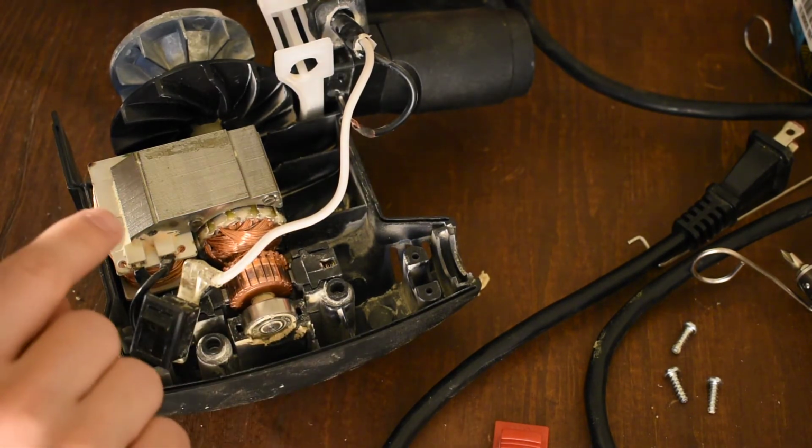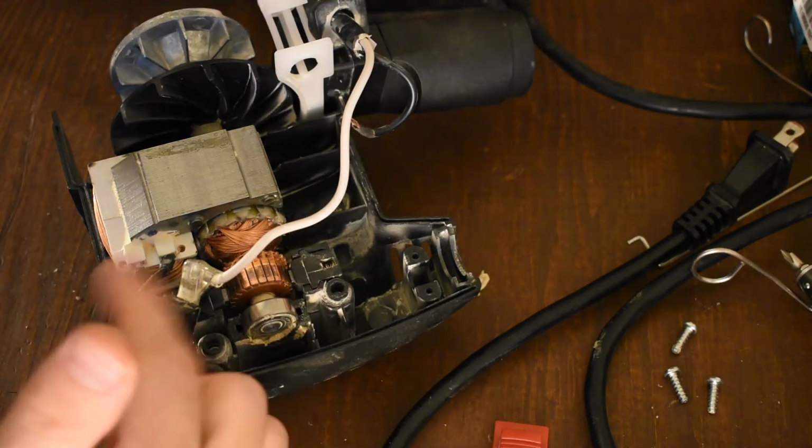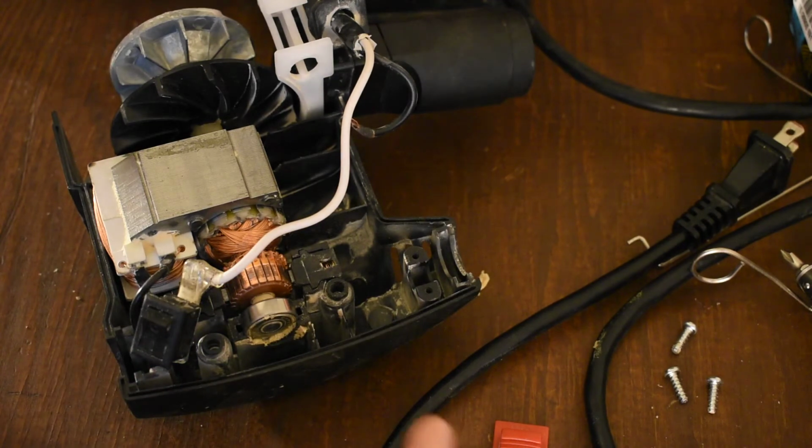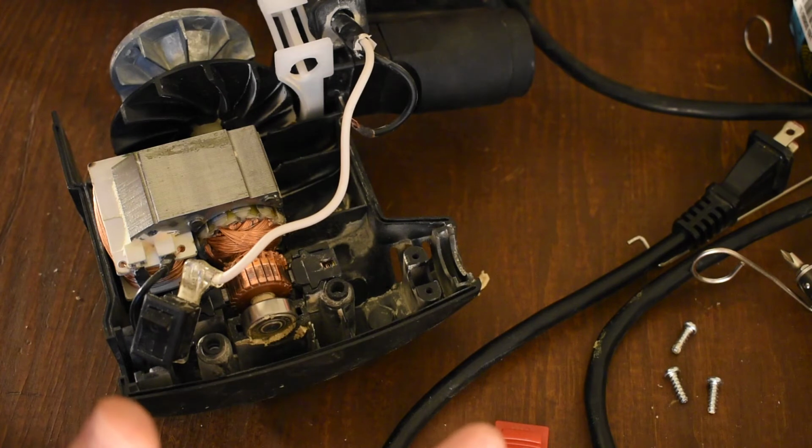They actually frequently won't work if you don't do this. If this was a solid chunk of steel, this motor might not work at all. The eddy current losses can get so extreme that you just generate a ton of heat, and like half the energy you're putting in is going to heat, and the thing just melts itself to death and it doesn't spin.